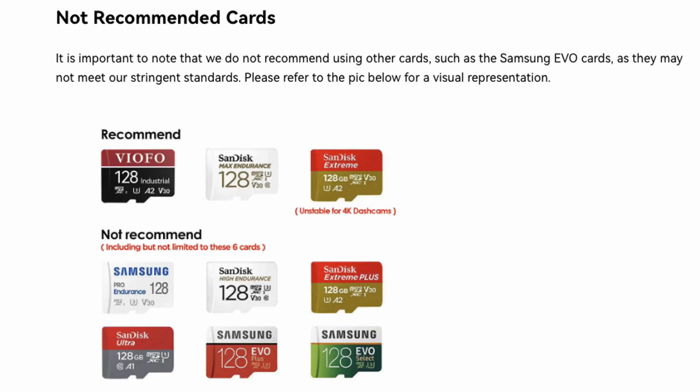Hopefully you have a battery pack to help your dash camera record while parked for long periods of time — that's probably why you've got a large solid state drive to begin with. I did ask Viofo about this about a month ago when I knew the A329 was coming out. A big issue we see with people buying cameras like the A229 Pro or A139 Pro is that they buy SD cards other than what Viofo recommends. Viofo specifically told me the SanDisk was recommended, which is why I got a one terabyte SanDisk — and it paired quite easily. It'll be interesting to see what other SSDs people try, but for now I'd recommend sticking with SanDisk. The integration was very flawless and clean. Always make sure you're using a USB 3.0 rated cable.